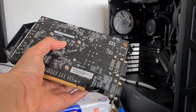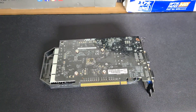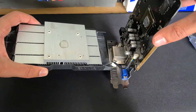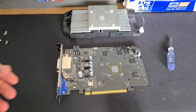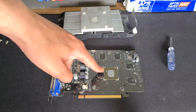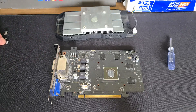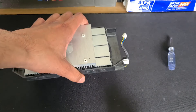It's time to take apart this GPU. All we have to do is take off these four screws and then we can separate it from the fans. All the screws are out and now we can just lift it up — and now it's got dust all over my desk. There we go, now we have the actual hardware separated from the cooling system. The main reason I also did this is thermal paste — thermal paste isn't infinite and you are going to have to replace it over time.